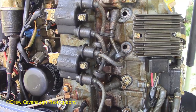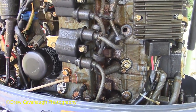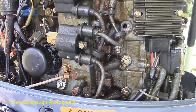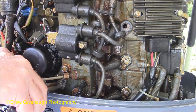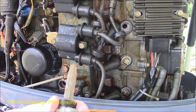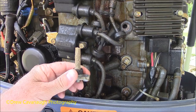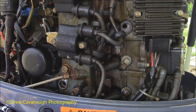The anode is going to be screwed into this bolt. So the first thing you want to do is remove the anodes and see what kind of shape they're in. I took this cover off — this is the anode. What you're going to do is pull it out if it stays intact, unscrew this, and the anode will come right out. You can see the corrosion on it, so it needs to be replaced.